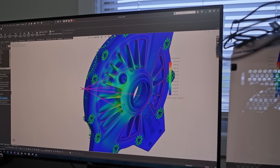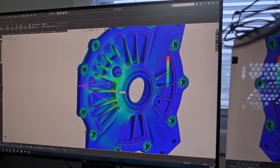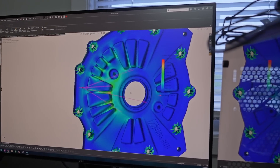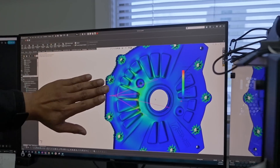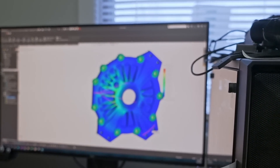That pushes out — you can see this high stress area here. Yellow and red indicate high stress points. You can see where the trusses are kind of building up. You can imagine this wants to twist the cover over, so that's why we have these two legs here to transmit and share some of that load.